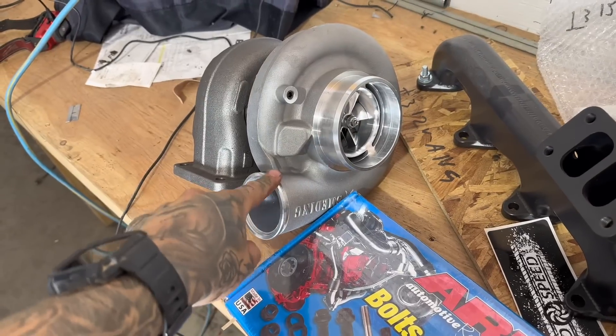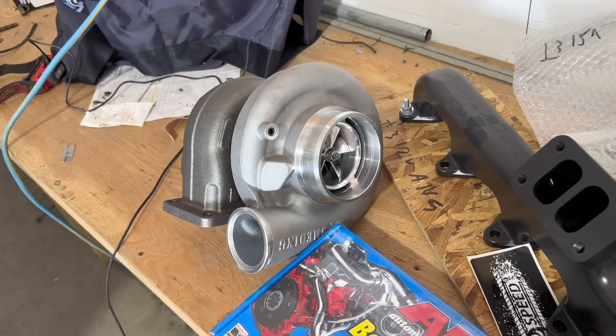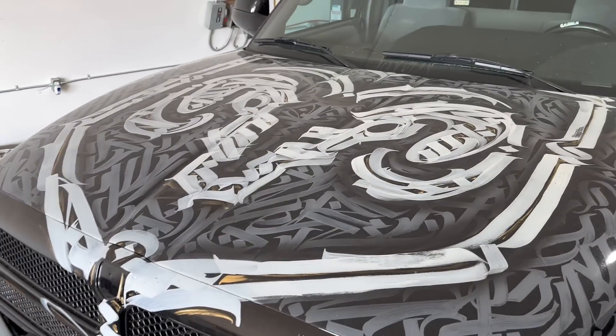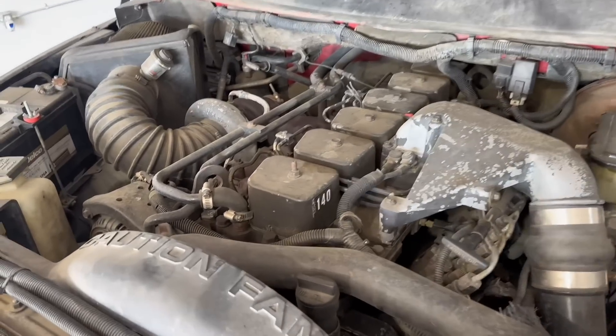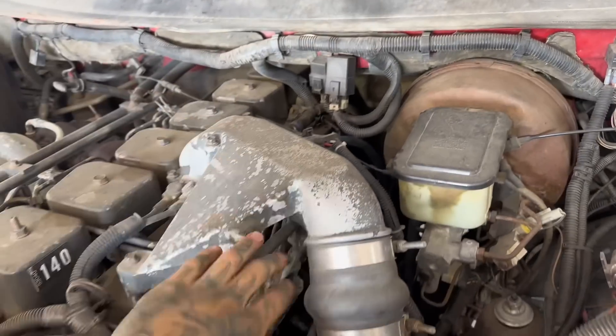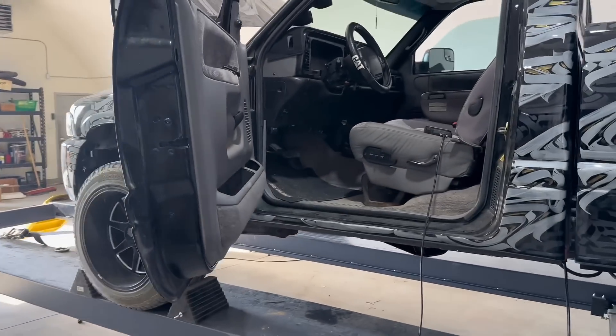This is a Smeding S369 and I also got the one with the steel 360 thrust bearing. Let's dyno this truck and see how it is right now. If you haven't seen this paint job yet, look at my calligraphy Ram logo — pretty cool. But if we open her up, she's basically stock: stock turbo, we got an air filter, I removed the fuel plate from my P-pump, and it has a five-inch exhaust. Alright, got her all set up, let's see what this baby makes.